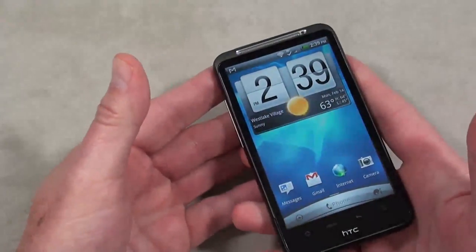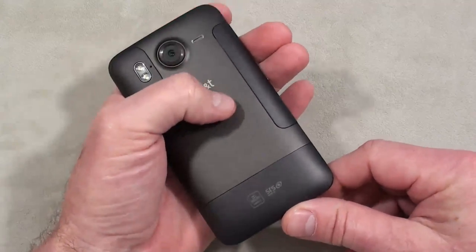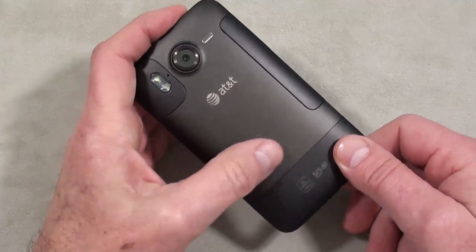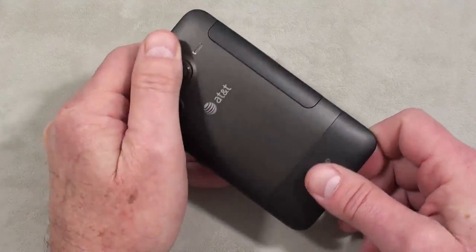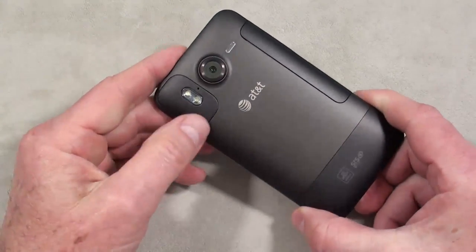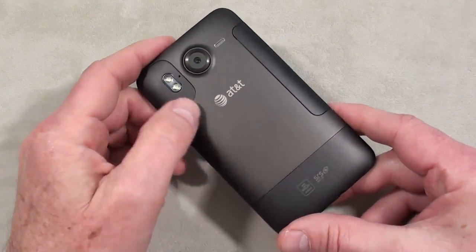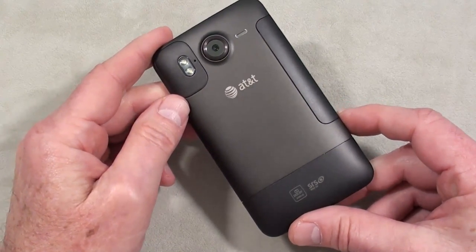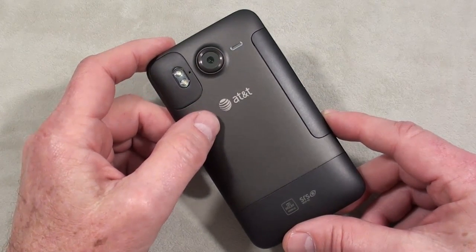Build quality: you've got a glass cover over the display. The case itself is made out of aluminum in that brown HTC color — not one of my favorites — but it has a texture coating so it feels solid. There's a rubberized plastic battery cover, a rubberized plastic cover for the SIM and microSD card slots, and a rubberized plastic cover over the dual LED flash. Under the battery cover is a 1230 milliamp battery rated at six hours of talk time. The camera is 8 megapixel with autofocus, geotagging, and face detection.